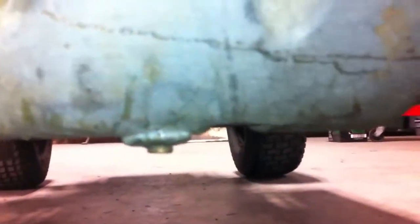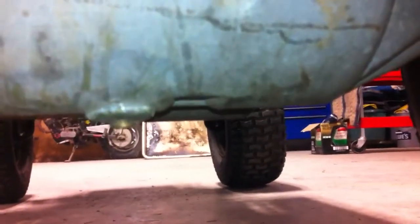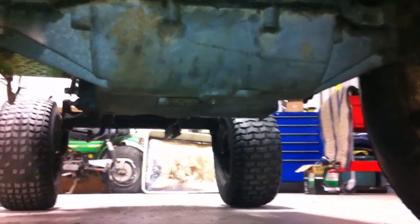The case was real thin right there, so I used that aluminum weld and built it up. As you can see, there's plenty of meat there, and I was able to drill it and tap it to put in a drain. It's a little bit vulnerable, but I'm not a serious mudding dude. I could protect it with a skid plate or something. Try this aluminum welder — you should be able to find this stuff somewhere.